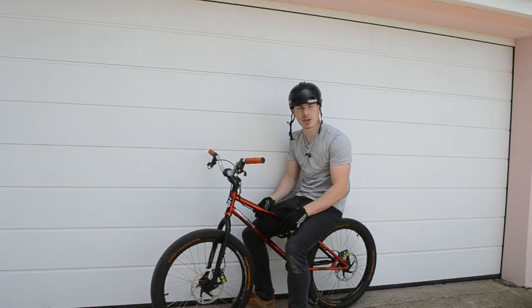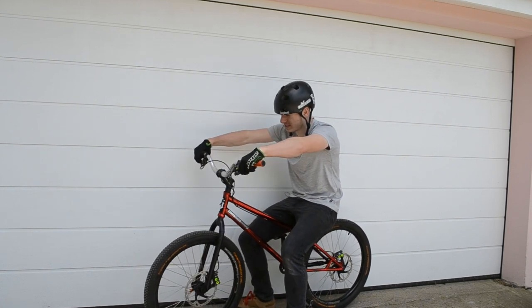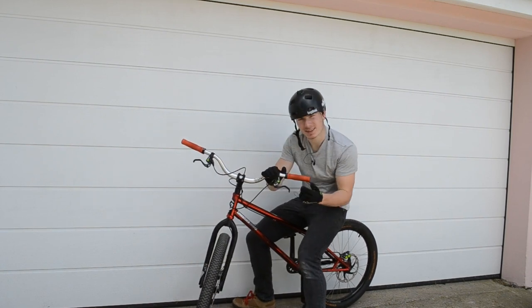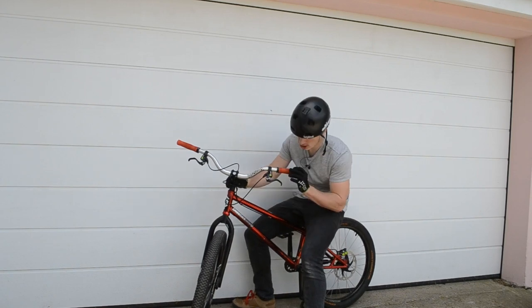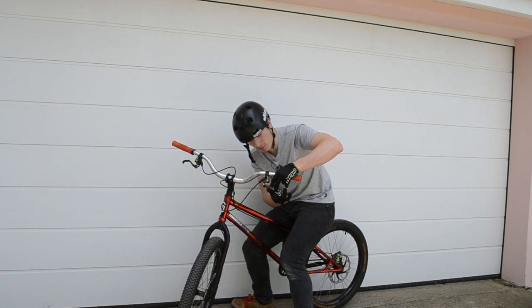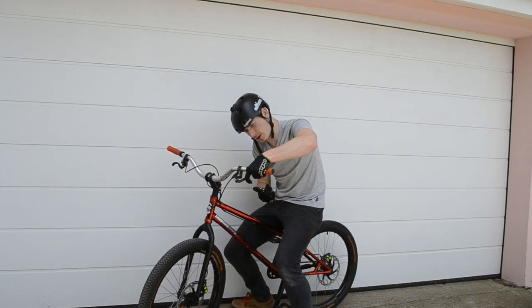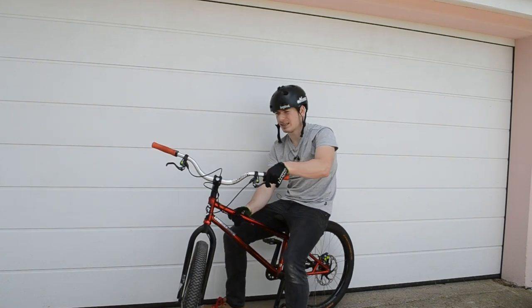We have the Magura MT7s all fitted now and I must say, just from squeezing them, they feel super super firm. You can tell straight away that when you pull it you've got a bit of travel, but instead of that travel being useless travel like it would be on a Shimano with servo wave technology, on the Magura you can feel the modulation happen during that travel. They are really nice but they ramp up really quickly as well — pulling, pulling, pulling, and then it ramps up and I'm stopped, which is going to be absolutely fantastic for trials.